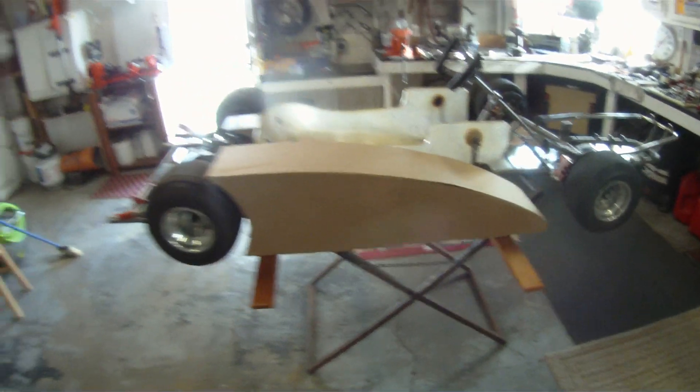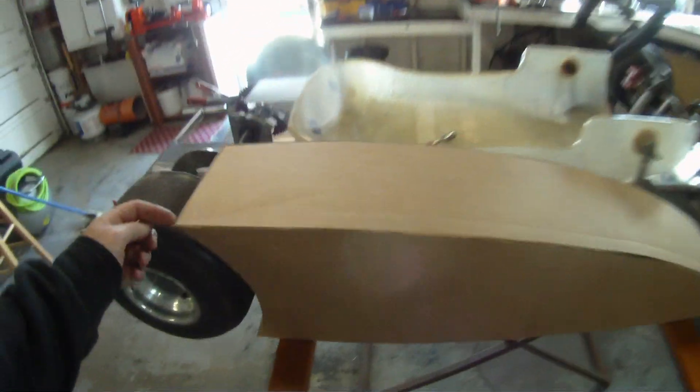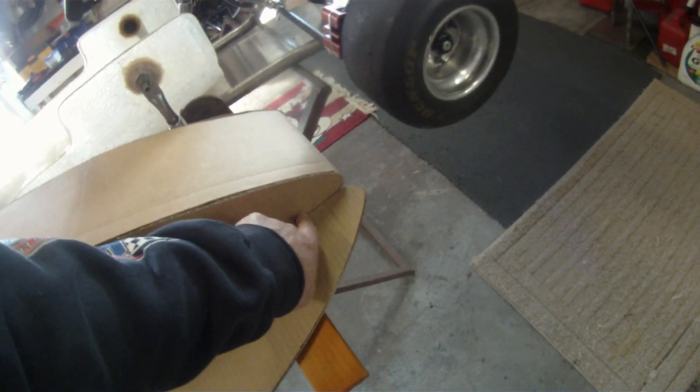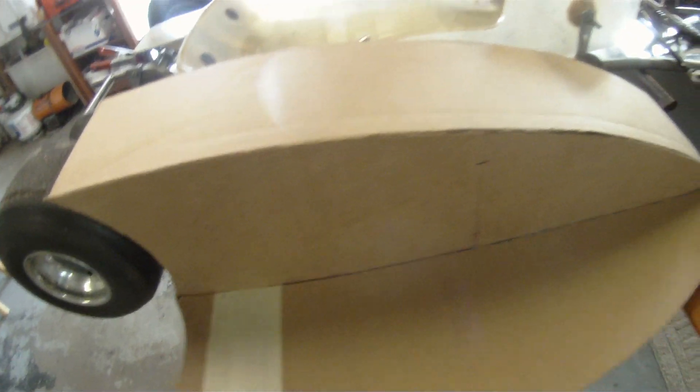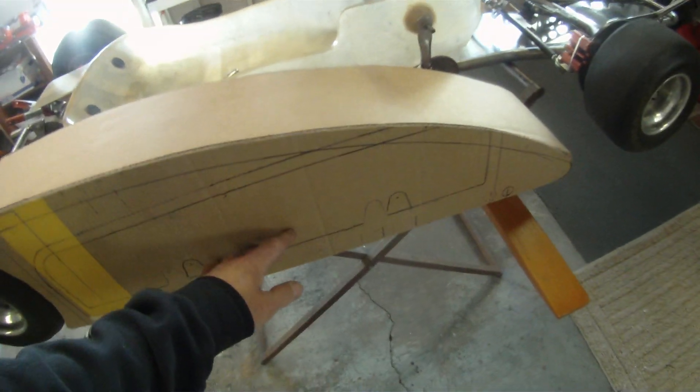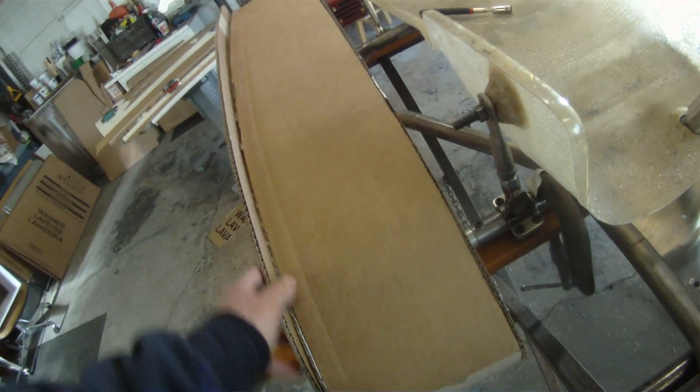Cut it down the middle and pull each side off. Or we just cut it right on the edge — because once we put our secondary piece on, instead of doing just an inch and a half of this surface to here and around to here on the bottom and then gluing this to a flange, I'm thinking about doing this whole piece but keeping this one layer. This would be two layers, and that way it won't be too heavy when we glue it all on. If we want to encase this whole thing, to cut it apart to get it off, we can cut it right on this seam, right on this edge. Because we're going to put a little fillet in here anyway to fill all this in so it's rounded, and that'll hide any of the marks from the cutting.